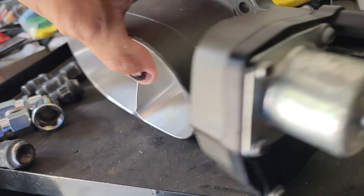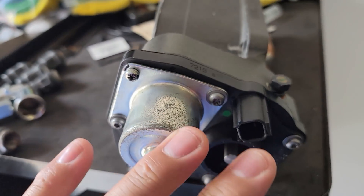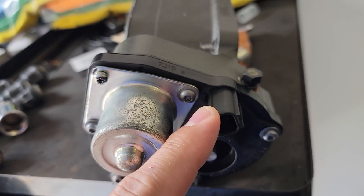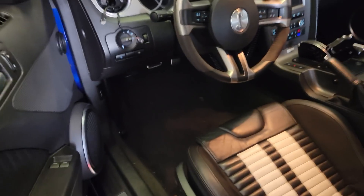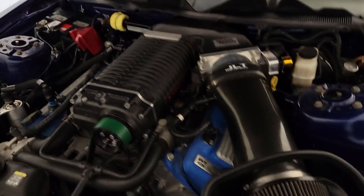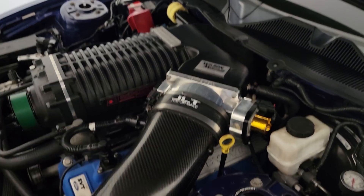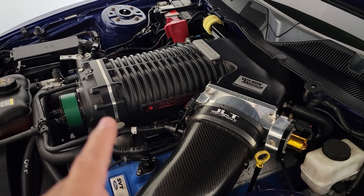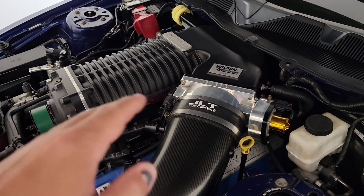If I go out here with the car running and crack the throttle and the car revs, then theoretically you can put a throttle linkage in this and make it manual - not electronic throttle control. Why am I doing this? I have a 2014 GT500 with a Kenny Bell 168 throttle body. That throttle body likes to shut when there's a lot of resonance because of the blower spinning at a bazillion RPMs. At really aggressive throttle, it'll start to shut going down the track at about 6,900 to 7,000 RPMs.